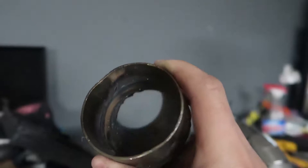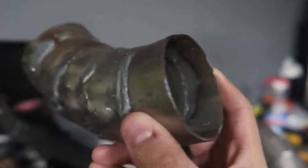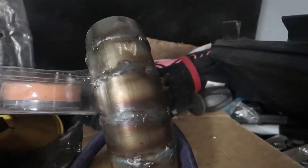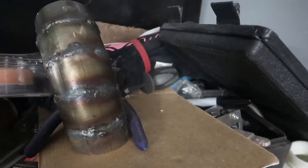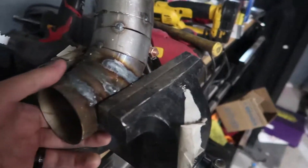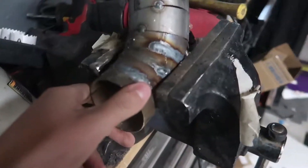You can see there are little BBs of spatter all over and I've got to get in there and clean all that up, because you don't want that stuff floating around in the tube — it gets sucked into your intake and intercooler, and you just don't want those things in there. I'm MIG welding stainless steel right now, and it's not terrible — not that bad, actually.